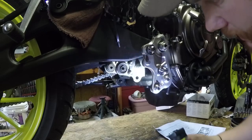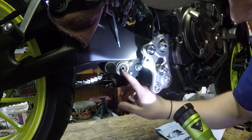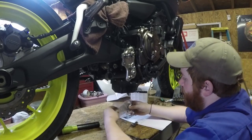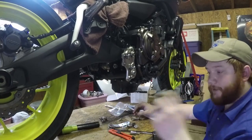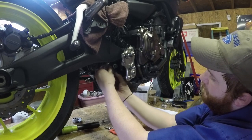After a quick glance at the manual, I can see we're going to have to move this bracket — which held the exhaust on — down two places. 10 millimeter, using that same ratchet. We move that and then install this little bracket. Once you take the two bolts out of this piece you put it away, and this bracket goes in its place. The bolts can only go in one way.